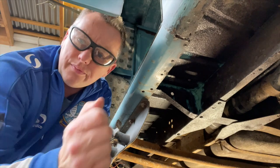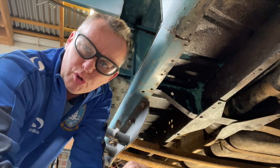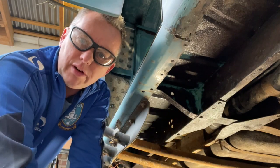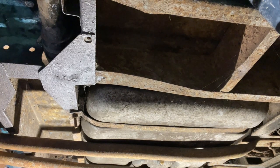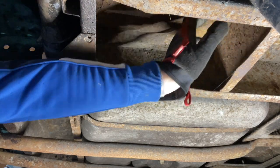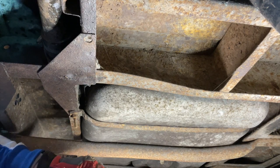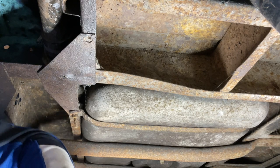Time to get underneath. I'm going to scrape off all the old paint, wire wool it, wire brush it, treat it, and then underseal it. I've done a small section at the back already. You can see how flaky the paint is — it's almost like there's no underseal on it from the factory. The paint just flakes off, gets mud on there. It's not corroded through in a lot of places, just surface rust, but we need to give it a good clean and get it off.